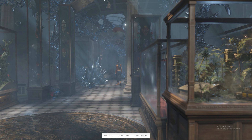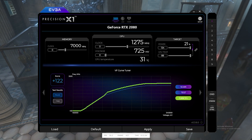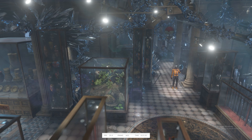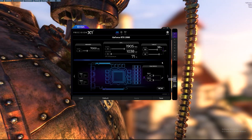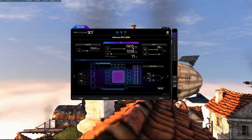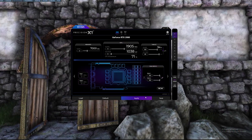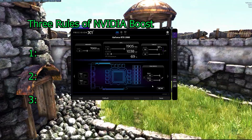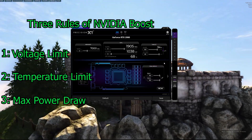So what makes Boost 4.0 different from 3.0? The major difference is NVIDIA has included an auto OC scanner. This scanner was in EVGA cards for the X series — it was a feature they made themselves. In this newest generation, NVIDIA has taken that idea and baked it into every card. So if you want to overclock, you don't have to do it manually anymore — you can have the video card do it for you, with some software, in a more hands-off approach. This is a step in the right direction, but you are still limited by the same factors of voltage, power, and temperature, and you can't get around that. So you would only go so far with auto overclocking.